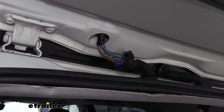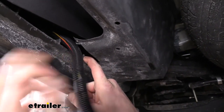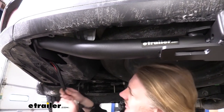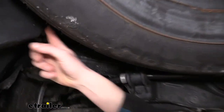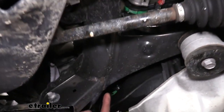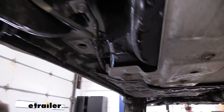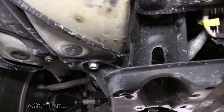We're going to move on to the wires routed towards the front — these go through that grommet, so we'll be underneath the vehicle. Both wires come down just above the under shield on the driver's side. If you've got a hitch installed, you've probably got it cut out already. We'll pull the seven-way wiring over towards the center to mount it, and the three remaining wires in the small harness route to the front of the panel. We stay above the rear suspension to avoid moving objects and anything hot like the exhaust, then come out on top the other side and run down next to the fuel tank, zip tied to the parking brake cable. From there, we stay above the panels all the way forward, and then the wire crosses over and routes up into the engine compartment.